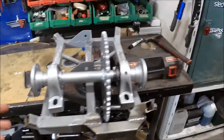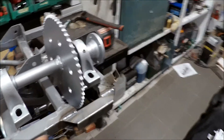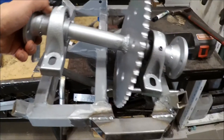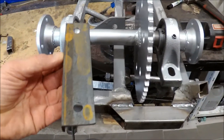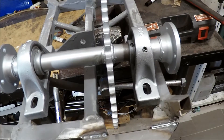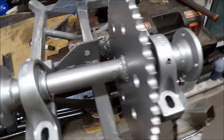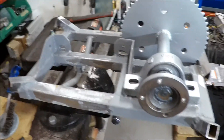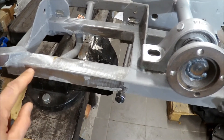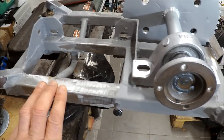I've been trying to fit this different gearing to the subframe for the motor and the cardan axle. I have to cut into the frame so the sprocket can fit. I also removed these flanges here so I will weld new ones on. These bearings are larger because I chose to build with a 30 millimeter axle instead of 25 millimeter, so it will be a bit stronger. I also have to change the motor to the 1304, and that one is a bit wider in diameter so I have to cut 10 millimeters so it fits.